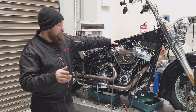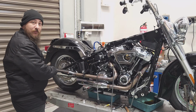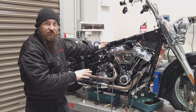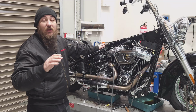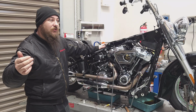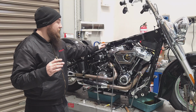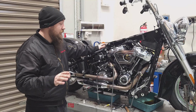For a couple of reasons. One, by the time the exhaust gas gets through the sniffer pipe to the sensor block in the dyno, there's a time delay, and so what's happening in the exhaust pipe doesn't match the RPM signal correctly. The other major flaw is they're prone to sooting up, and you don't know how accurate they are at any given point in time unless you're cleaning them every single session. And nobody's got time for that. So I can't be bothered with it.